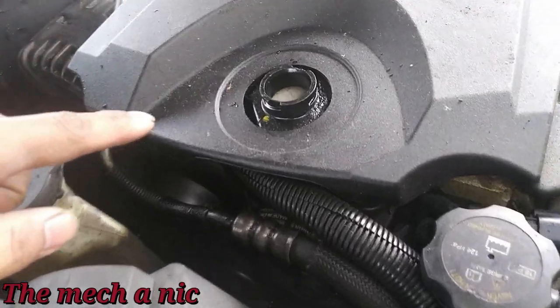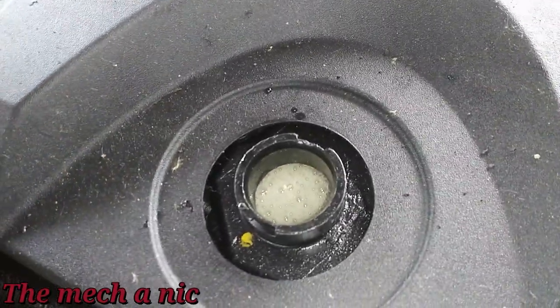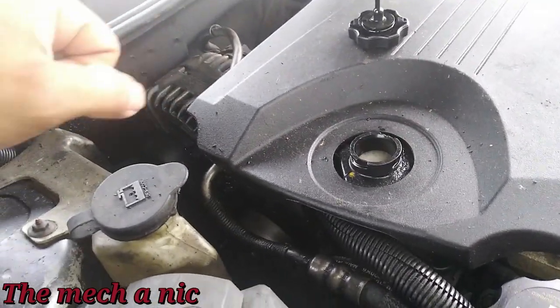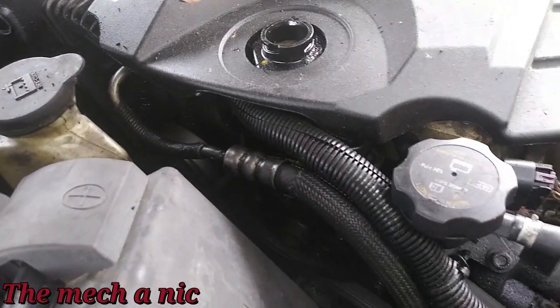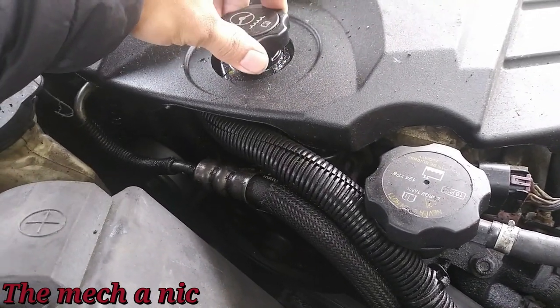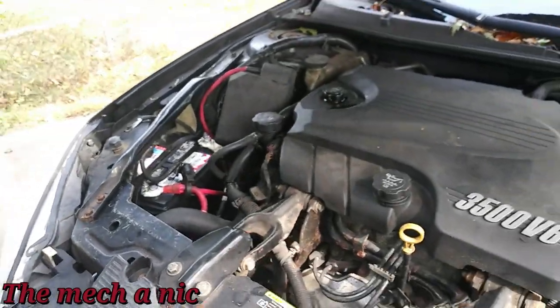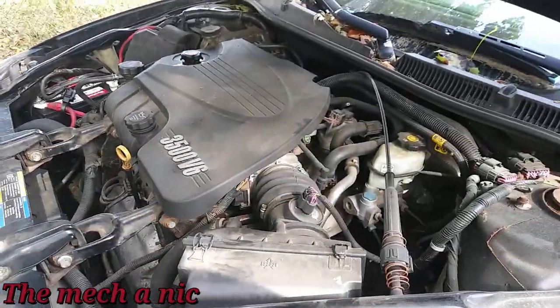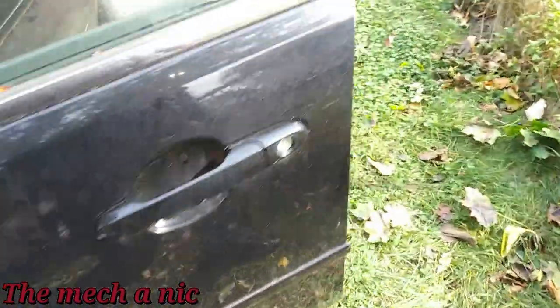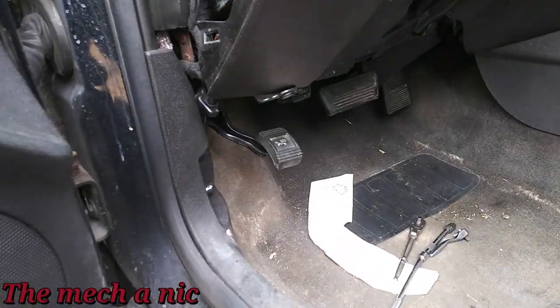It's now the next day. The reason why the power steering wasn't working is because there was practically no fluid in there. I added power steering fluid but as soon as I started the car it just started to froth up. I did start to get some sign of the power steering working. It's probably the rack and pinion leaking out all the power steering fluid. I kept trying to get the air out of the system, and the power steering seems to be working now — everything is topped off. The pump is still winding and making noise, but at least we have power steering and it's not difficult to turn the steering wheel anymore.